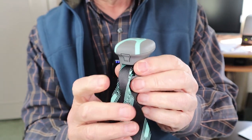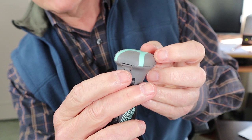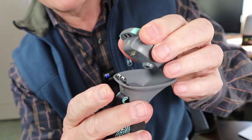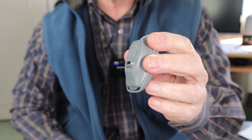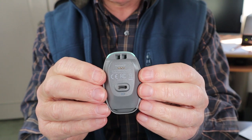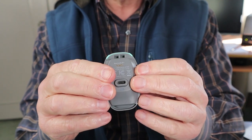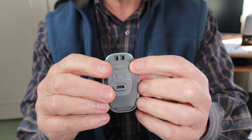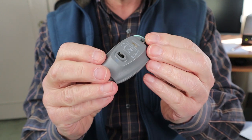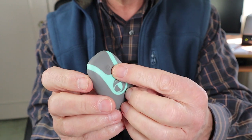At the base of the grip there is a push button on the back that you press to release the battery from the pole. What we have is a 1300 milliamp-hour lithium polymer battery with a USB Type-C charging port. It is an encased battery with no access to the cells, which aids its waterproof rating.